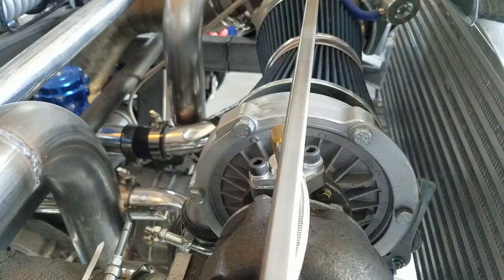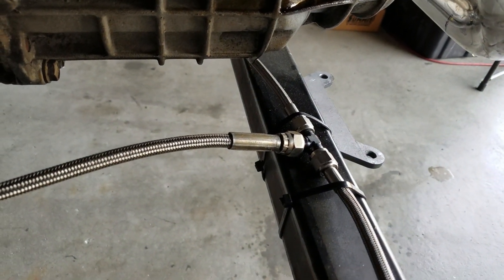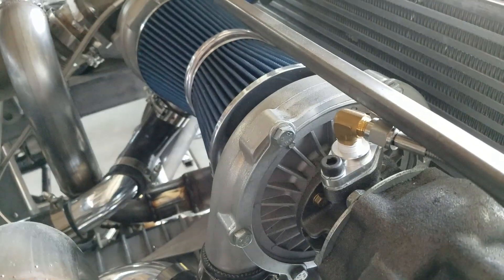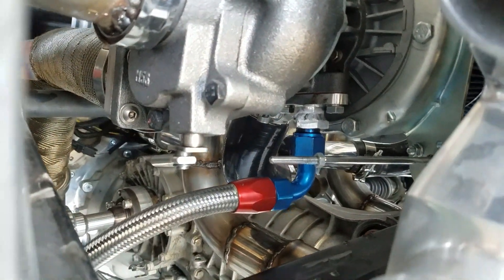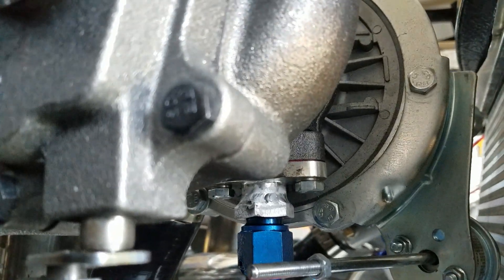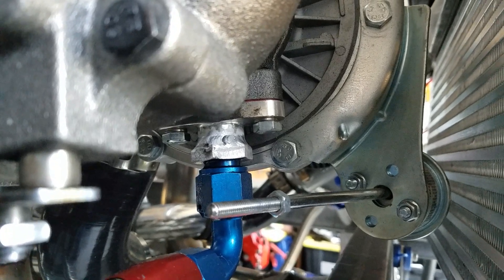Now let's talk about what we're going to be doing today. The turbos need oil — they're actually cooled and lubed by engine oil. What we had to do was modify that port to take a high-pressure hose that then goes into a T. Those are dash-3 AN fittings, and that delivers oil to the top of both turbos. That went pretty well. The problem was the return line down here — we had to make that because we couldn't find a really good AN fitting, so I actually made my own. We did some welding there, and on the other side it was leaking so I had to tighten up that connection.